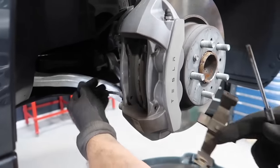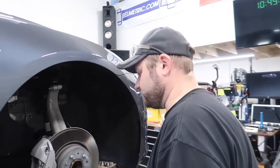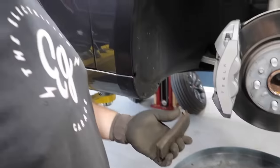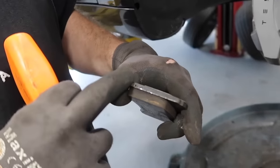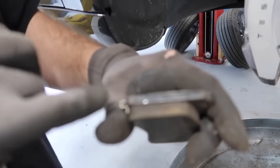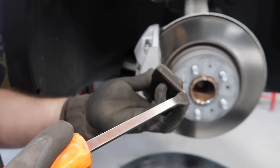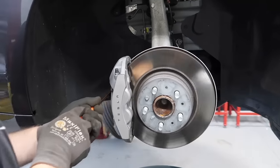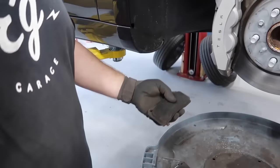This one slides out a bit easier. There's still corrosion on it but it's not as bad. I've had to take rotors off and use pry bars and hammers to pull these things out of calipers before. You can actually see the bubbling of the corrosion — when I take the wire brush to that, the paint's going to flake off and you'll see rust. It's normal — it's not like something's catastrophically wrong with the car. It just happens. This is why annual service is important.